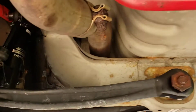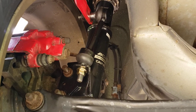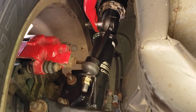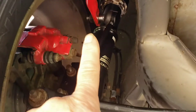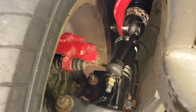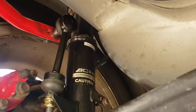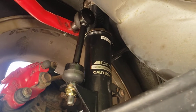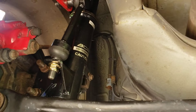All right, I'm going to show you back again on the other side. That's the Hotchkiss bar, that's the way it looks right there. I mean, you want to get crazy and drill it a little even bigger, you can, but then I didn't want that thing to stick out too far past the wheel. So that's good right there, it's nice and tight, it's not going anywhere. You can see it's got plenty of clearance with the BC Racing coilovers, and it's not touching any of the brake lines or anything.